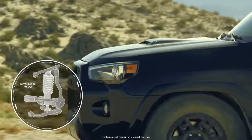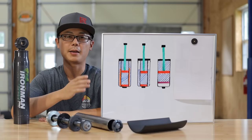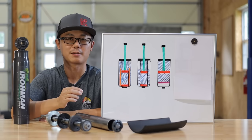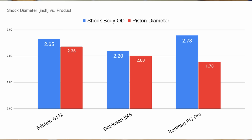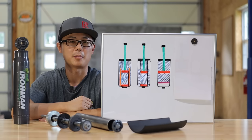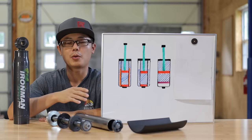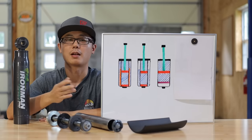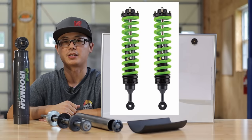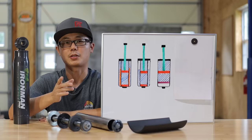Among these three, if you like high-speed off-road, the Bilstein 6112 is probably your best bet — it has a similar outer diameter but being a monotube it has a much larger piston, which in theory allows higher damping force and more precise tuning. The Dobinson IMS is a 2-inch diameter shock with less oil and thermal mass compared to the other two, and despite being a monotube it doesn't really have an edge over the Ironman. The IMS does have a threaded body, so I would only pick it if you really like how a monotube shock rides — which tends to be stiffer — and you really want a threaded body. Otherwise, the Ironman Foam Cell Pro is my choice if I'm not hitting serious high-speed off-road, and Bilstein if I do.